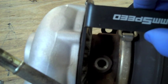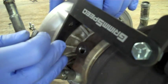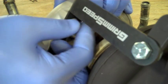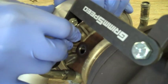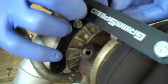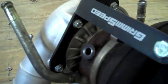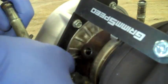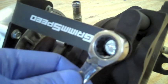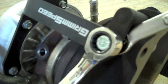When you hold it up in place, you're going to notice there is a bit of a gap between the bracket and the compressor housing. Don't be alarmed — this is a good thing, because we need pressure to hold that wastegate door shut when we tighten these bolts down. Hand thread each one of these in; don't go tightening just one all the way down. It may take a little bit of strength to keep it in place, but that is a good thing. If it fits completely loose, you might not have the right bracket for your turbo. When tightening, switch from bolt to bolt so you get even pressure across the bracket. Only tighten these snug because the bolts are threading into semi-soft aluminum. Now take both 13mm wrenches and tighten down the nut to this bolt — make sure this gets much tighter than those three bolts into the compressor housing.